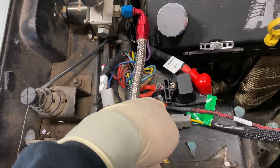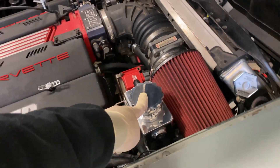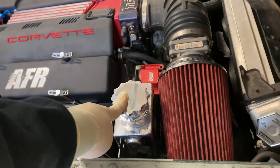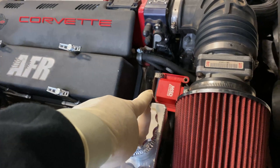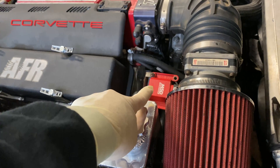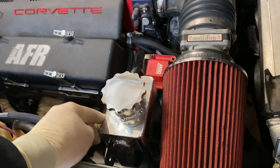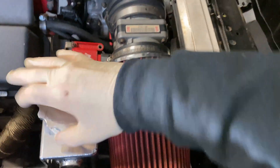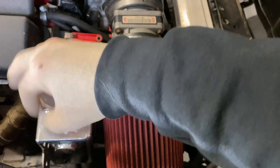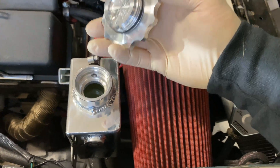What I did was make a short post to minimize risk, fused at 30 amp and 30 amp. This side is going to the fan controller. And we have an expansion tank — it took me hours and hours to figure out where to put it and how to get it mounted with the coil in the way. For now, this is what I've got. It's a real good quality from Summit — Summit branded, thick aluminum with a billet cap.